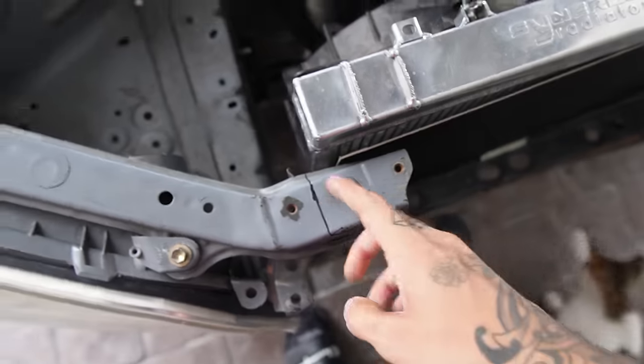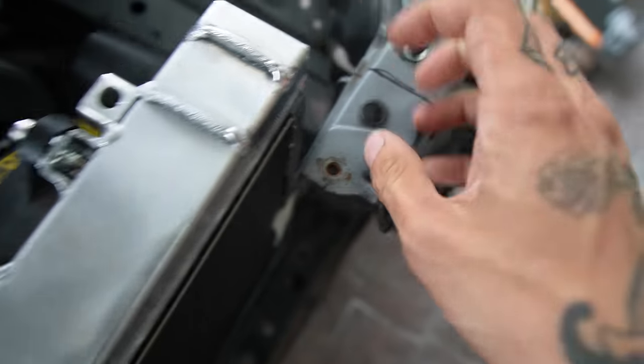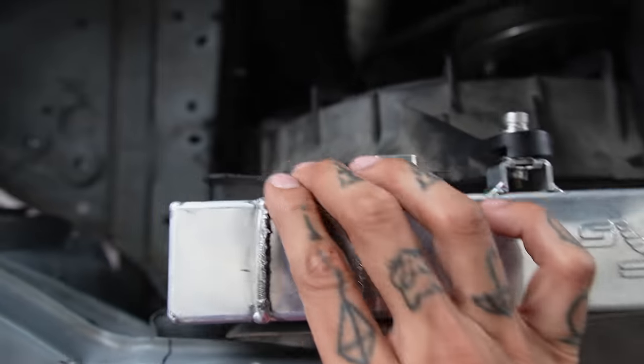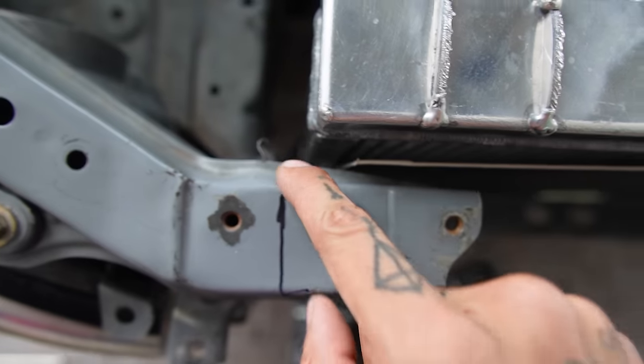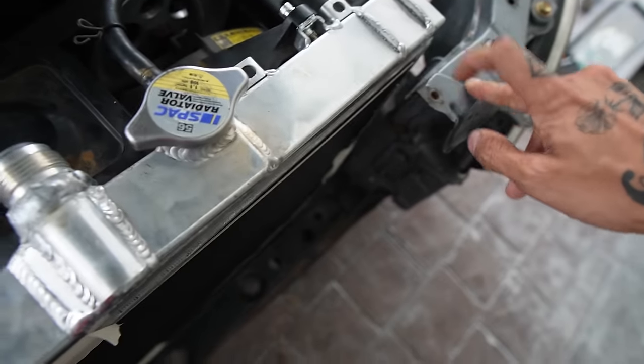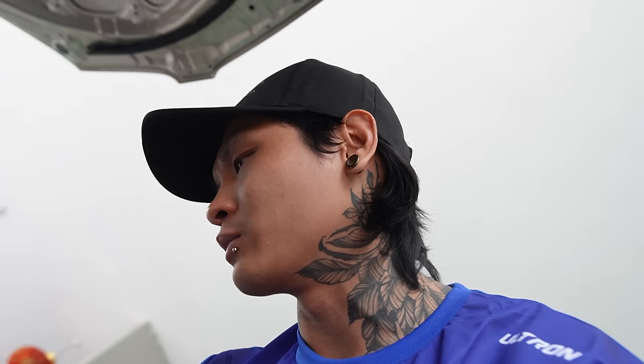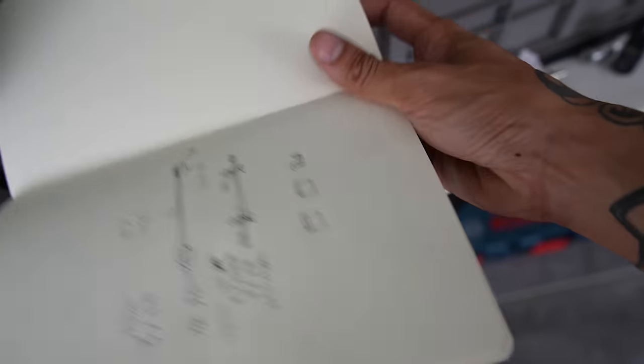Right now I'm just trying to cut part of my car body. It's not really a main chassis so you don't have to worry — this is just the piece holding the radiator. I want the radiator to slightly tilt by a few mm. I think I might as well cut this whole piece off and make a new bracket for the radiator. It's also better for the clearance for the fan. This is the first thing I'm cutting off my car body. A bit nervous, but I hope my design works — I've already drawn it out. That's basically the design I'm going for. Time for some grinding!